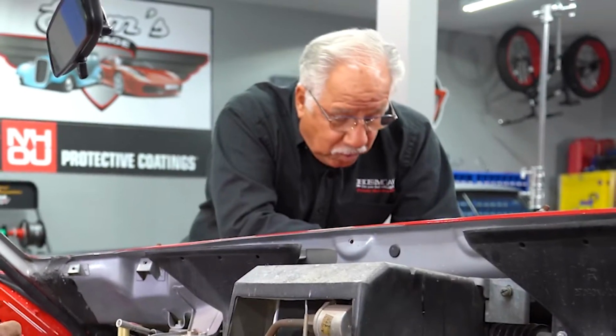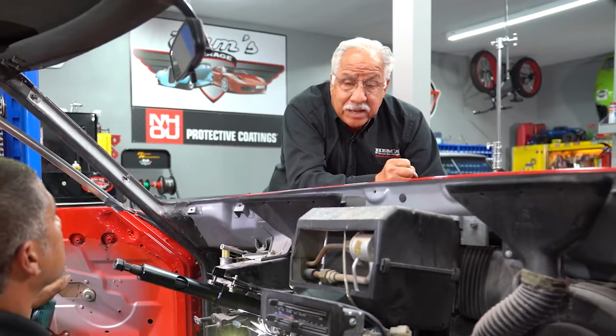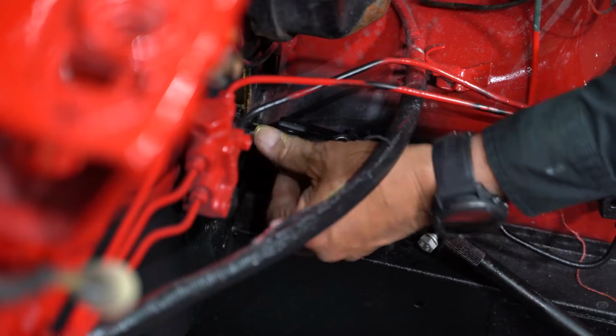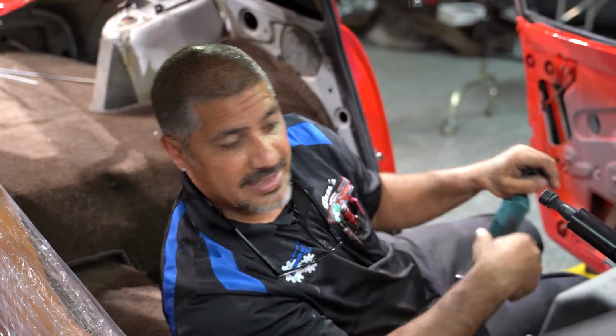Yeah, and it's also important when you're trying to line up the shafts, you can run into it where it's closed because it uses a bolt to clamp down. If you need to, just get a little flathead screwdriver, wedge it into it, and what it'll do is open everything up so everything will slide together. Then you can line it all up, get your bolt and get it tight. Otherwise, a lot of times you're going to fight it. And it doesn't hurt to use a little bit of lube as well. Yeah, WD-40 or PB Blaster.